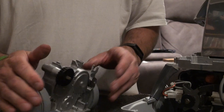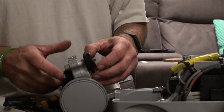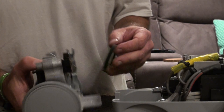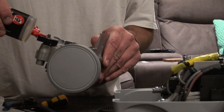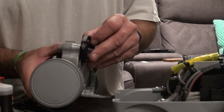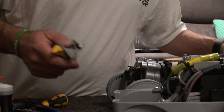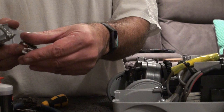Okay, now what you've got to do is lift that, keep that bar up when you feed this in. If you remember, our belt stays flexible. Okay, so what we're going to do, in fact, while we're here, a little bit of lubrication just on there. Wipe the excess off. Okay, and that belt goes on there. So we hold that up. Nearly forgot the other part. So got this bit, and we have to put the other bit there. Okay, so this pulls in there, that square bit goes over there and twists and locks in place.